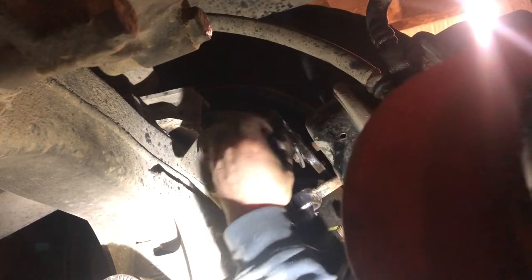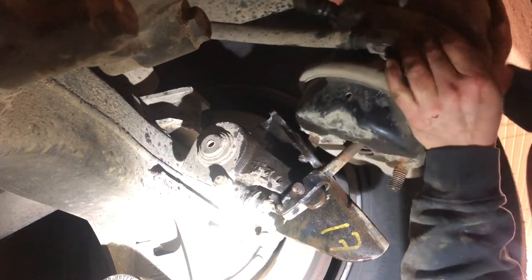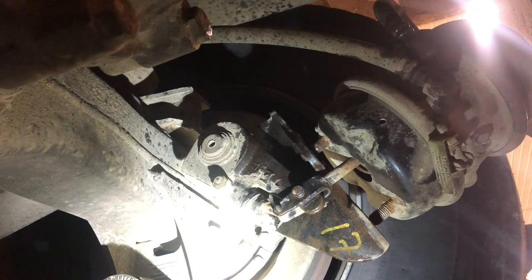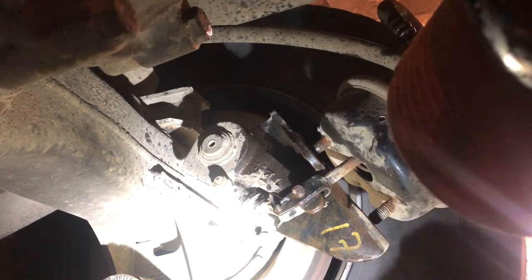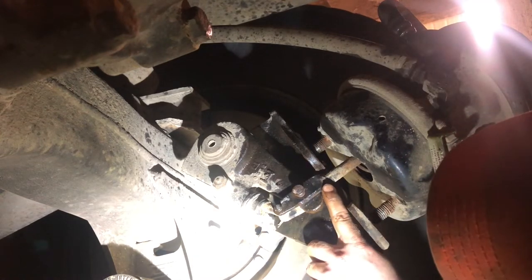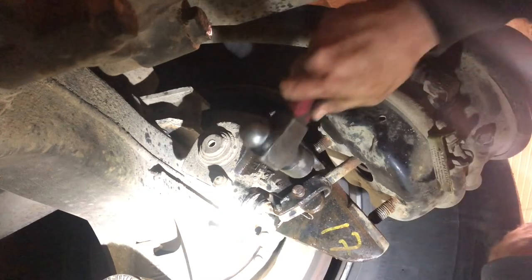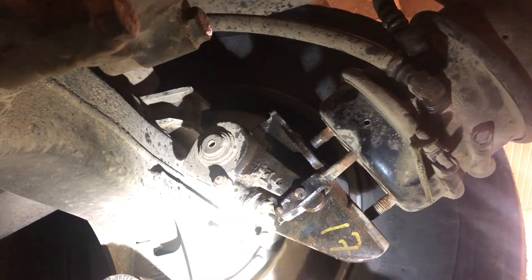These pins aren't too hard to get out — they get a groove worn into them. That can is beyond hammered. You can torch cotter pins off if you need to or you're in a hurry — just nip them off, it's way faster. The cans come with new nuts, washers, and clevis. Don't get your butt kicked by these little cotter keys. Grab a vice grip and try to get them out straight; if all else fails use a small punch and hammer to knock them out.